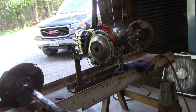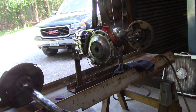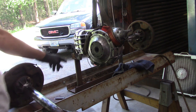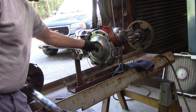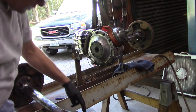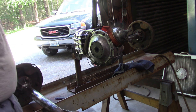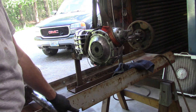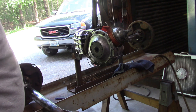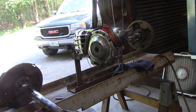So a little bit of a delay, take a look at it and see what's going on. The fact that there is a seal here really does eliminate the need to put RTV or something on that, so I may refrain from that, just so this gets a good metal-to-metal bearing surface when the bolts are torqued up. So, all right, back to the drawing board.